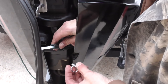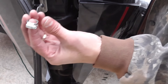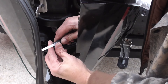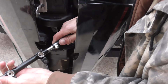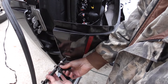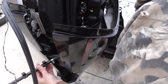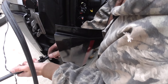Now let's look at reassembling all this. As part of reassembling, I'm going to be putting a regular type of hose clamp on here. If I ever have to do this again, I want it on an orientation that I can actually get it off without going through so much effort. I'm going to put this right there like that, and it simply goes up inside there. We're just going to press this back together — it snapped right at the end. Now that I've got this spun exactly the direction I wanted, I'm going to go ahead and tighten this down. You don't have to tighten it so incredibly tight that it's poking through the hose — just enough that you can see it compressing the hose a little bit and you can't spin it.